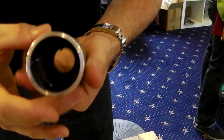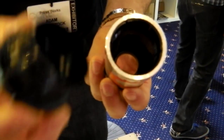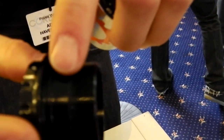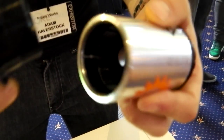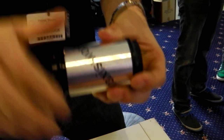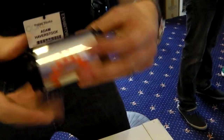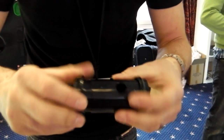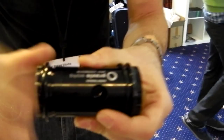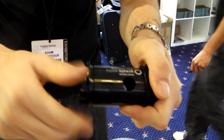On your bike you can see the collets just waiting for the drive cup. Your mechanic takes the drive cup — if you look closely, this is a wedge here, that's the male side and this is the female side. You thread this down with your Shimano tool. As you're threading it down, you don't have to worry about a torque setting, because it's machined so you basically turn it until it bottoms out. You'll feel the friction build up as the collet expands; the mechanic grabs a second tool to hold it steady and bottoms out the drive cup.